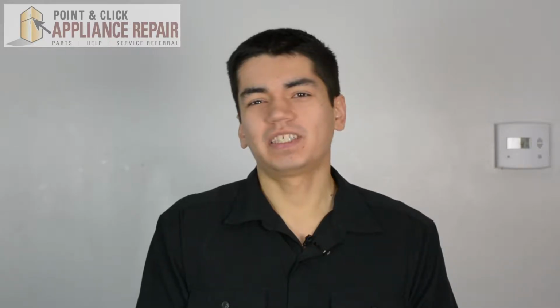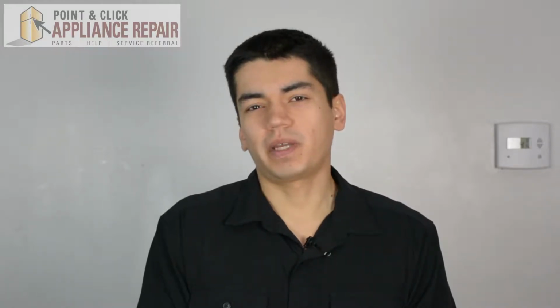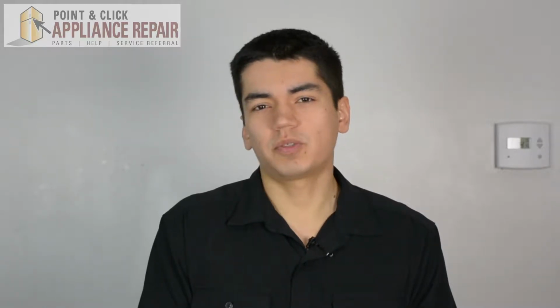Hi, my name is Bill, and today I'm going to be showing you how to replace the idler pulley arm in your dryer. The reason why you might have to do this is because the drum isn't rotating, or when the dryer is running, it's making a squeaking sound.